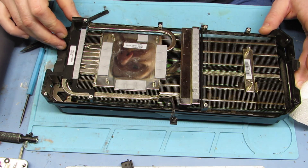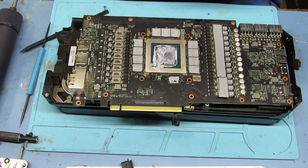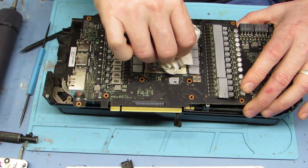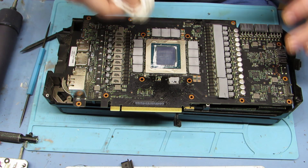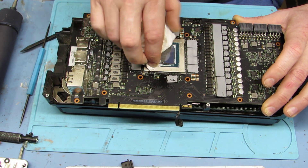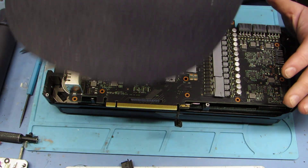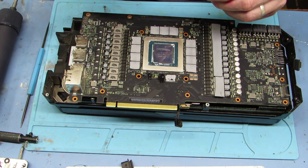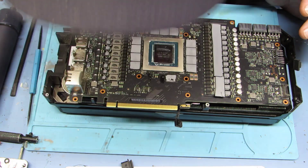Make sure your thermal pads are all in place — make sure they haven't come loose. You've got some on the bottom and also on the top, so if they're hanging down or not where they're supposed to be, go ahead and readjust them. If they're ripped, torn, or damaged in any way, you can get replacements. These all look pretty good. They also have upgrade thermal pads with more heat dissipation available if overheating is something you actually need to address.